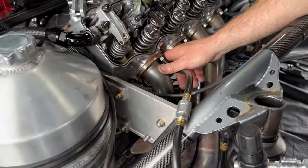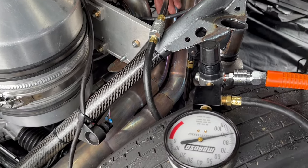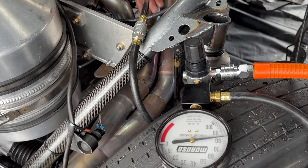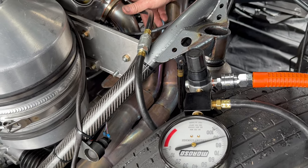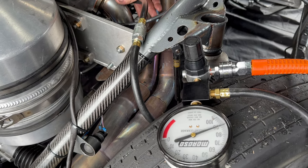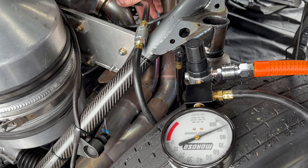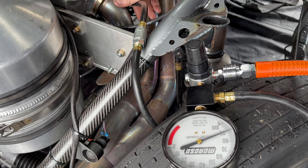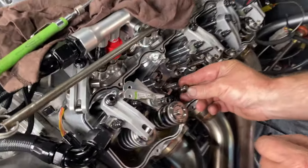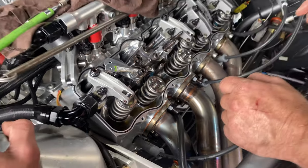So what are you doing now? Finding top dead center. For what reason? Just so the piston's at the top, so they don't have to fill as much air into the cylinder, the whole pressure. Should see the needle start to go back the other way as the piston rocks over. Getting close now. Yep, and there we go, that's top dead center. So compressor's kicked in, 8% leakage, and replacing the collets now. And spring back on, should be ready to go.